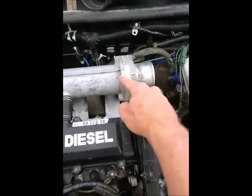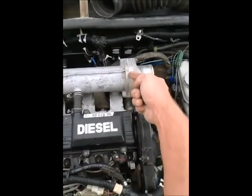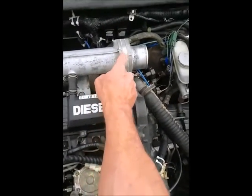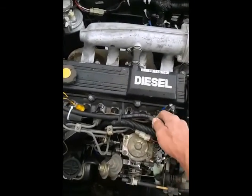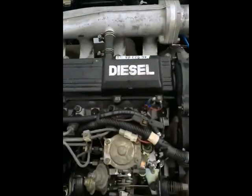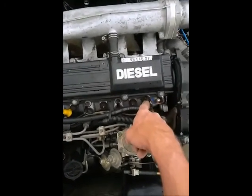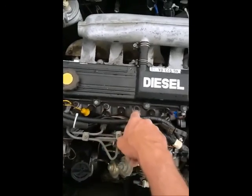I've got the air filter off of it because I had to try to figure out why that was getting smoke - right there when I hooked the battery up. You can see where it separated, so something went wrong in this little heating element. But apparently it doesn't really matter because it's running without it. I did test it and I've got only two glow plugs that are any good.